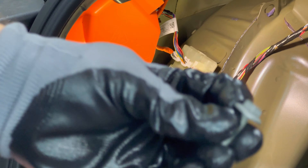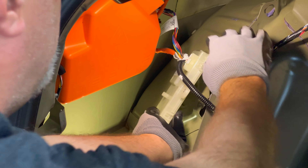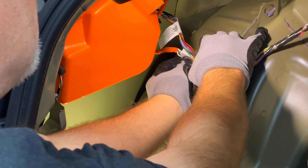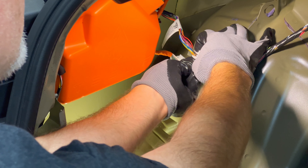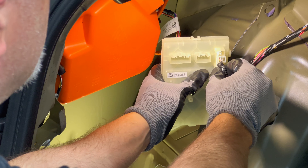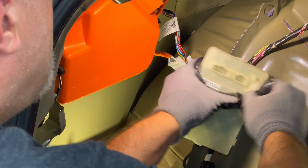To get the ECU out, it will have two plastic clips holding it in, so carefully slide it out to the right. There are three wires attached to it. You need to make sure the wires go to the same locations on the new ECU — take a photo with your phone to help you remember. The red wrapped wire is on the left, the bare wires in the middle, and the plastic coil covered wire on the right. The left and middle connectors were easy to remove; however, the one on the right had a tricky clasp that I needed to use the small flathead screwdriver on to release.